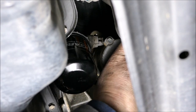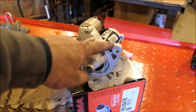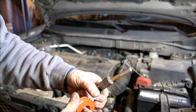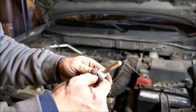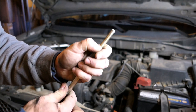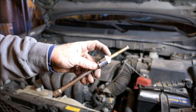You might have to go from the top to get it out — probably the best way, but I doubt I'll do it the best way. If you're ever unsure of how many bolts or the location of them, just look at your new part. So long as they gave you the right one, you should have a little guide there of knowing where everything fits. Both mounting bolts need to be finger tight first before you snug them down tight. I'm going to show you this little trick I do — many people will not approve of it. I just wrap it around the socket. They make magnetic sockets, which would be awesome, and there are other ways people use to hold the bolt in. Just holds it in there kind of temporarily so you don't lose it. When you rip this off there'll be a little of that Teflon tape left on there — I don't think it's a big deal. Just wanted to share my goofy little tip; it's bailed me out many times.